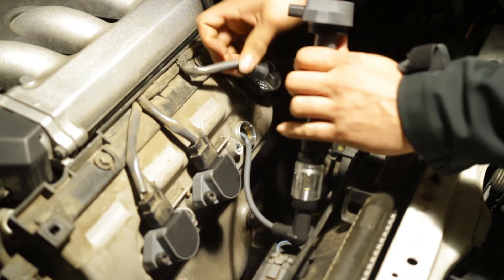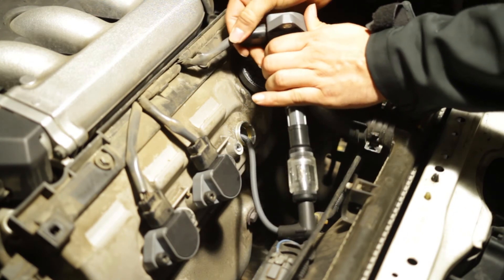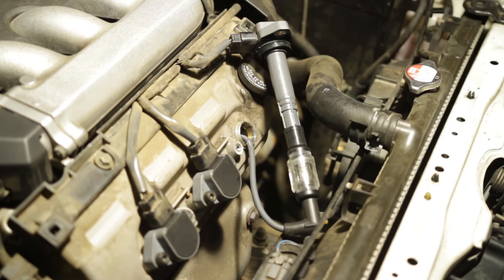So I'll plug it in like so. Once again, I will shut the light off to give you guys a visual of the spark plug tester. Here we go again — let's start the car. And as you can see, you can barely see the arc from the spark plug tester — it's not really lighting up. That tells me right there that that coil is bad, and not the spark plug wire or the spark plug inside the engine. Hope you guys enjoyed, and hopefully this helps you out if you ever need to diagnose a car.